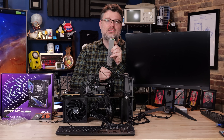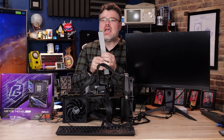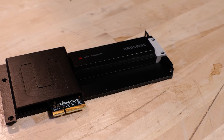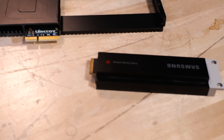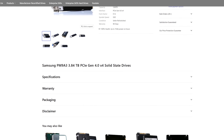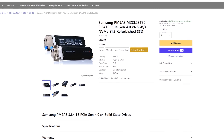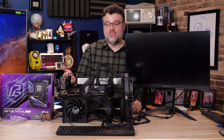The problem is the interface — this is an E1.L drive. L for long, S for short: E1.S. Then there's E3, which is wider. There are adapters — this one we have on the Level One Tech store, from UMC Koi. This is a re-driverless PCIe Gen 4 compatible E1.S adapter. I've also got a PCIe Gen 4 Samsung PM9A3 — you can order these from ServerPartDeals.com. So this is a PCIe card we can use in here, and that is a four-terabyte E1.S that performs well.